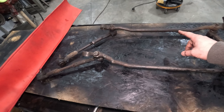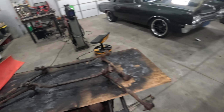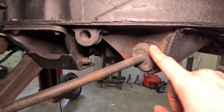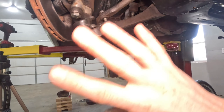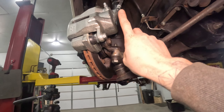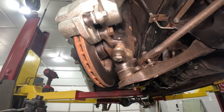Before we do that though, we'll come over here and rip out the old tension rods with these absolutely incredible bushings. We're going to undo these guys from the lower control arm, so essentially we'll just drop out the whole front suspension like we did before. The struts, coilovers, and brakes are just going to hang by the four bolts that hold the strut into the tower - they'll dangle there. That'll be fine, and then we can reassemble everything with all the reconditioned parts.